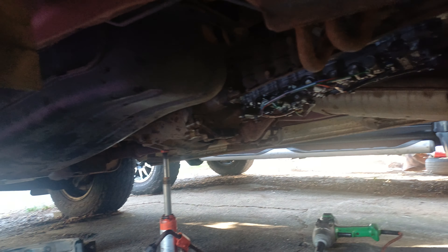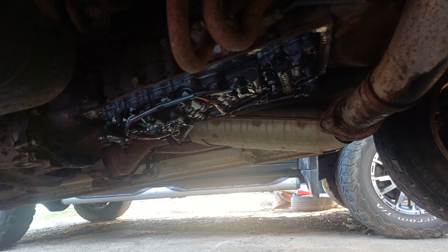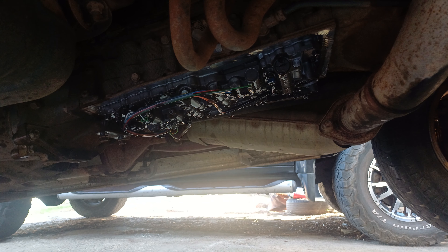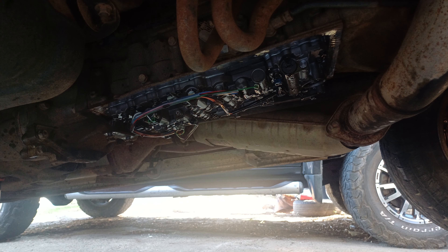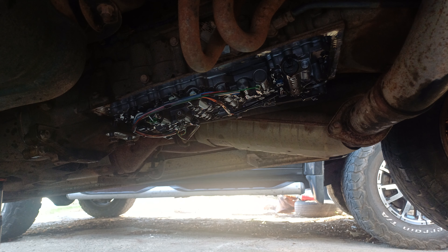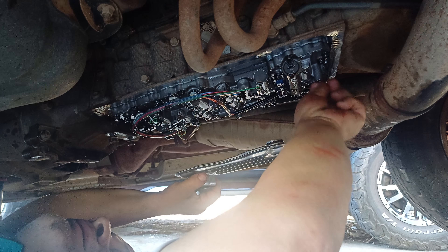It's time to put the filter on. All I did is put a bit of oil around the rim. Now I'll need the 10 mil. Most people use a torque wrench but I don't bother — I've never broken a bolt in my life. These filters go into aluminium so if you torque the bolts too hard you're going to break it.